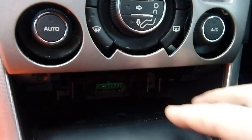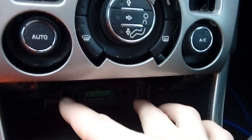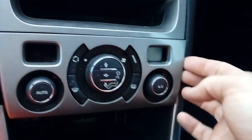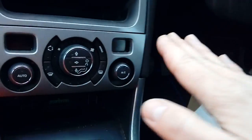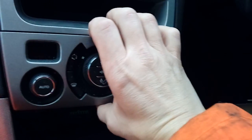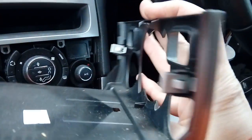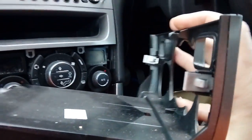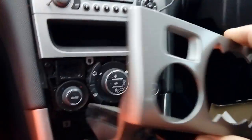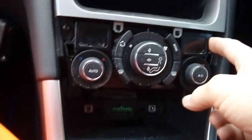Both screws are out. The reason I don't remove those first before unclipping is because in the past I've noticed people remove those two screws first and then start levering up, and what that does is snap the top two brackets off. So if you pop it first like I showed you, it just takes the strain off the top edge, and then your screws quite literally just let it easily pull forward. You've still got your two clips either side intact — it's just a little tip. I've done loads of them and you don't want to break it.